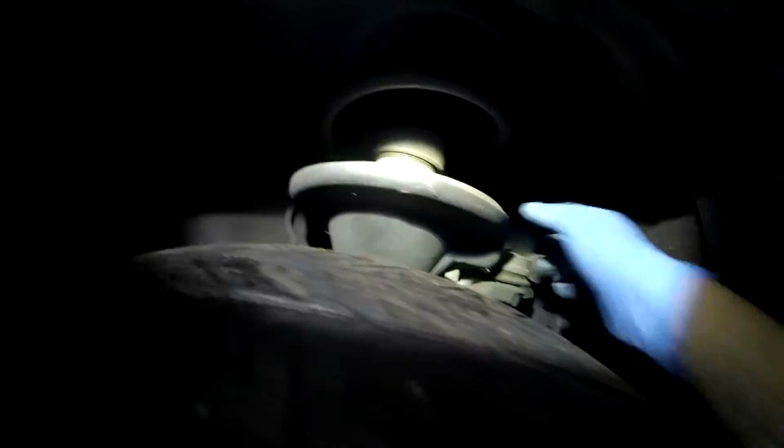And then I believe there's supposed to be something here, maybe not, but this is a tie rod. You can see straight how it connects to the steering rack, and I don't see an inner tie rod. Maybe they don't have one, but make sure this does not move crazily. This one has a little bit of play, this is very reasonable.